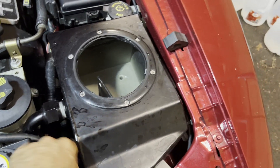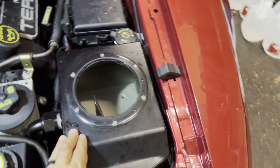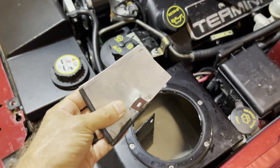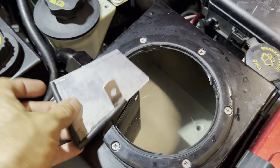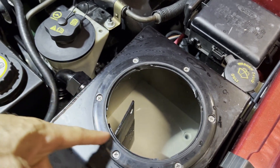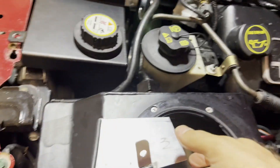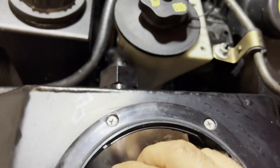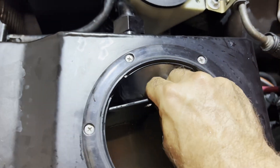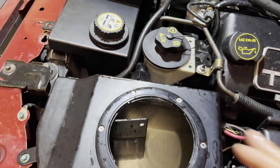I should have moved the return below the water level, and this baffle or deflector should have been angled differently or removed — it causes the water pressure to shoot up super high. So I made this little piece: it's a piece of aluminum with a part welded going up, a hole drilled in it matching a hole in the tank, and rubber on the edges to seal against the baffle. It makes an L-shape, seats in there at an angle, and deflects fluid down. I made it bolt-in rather than welding it permanently so you can still access the lid hardware with a socket.